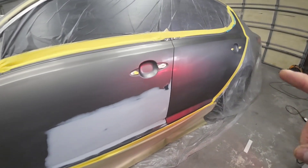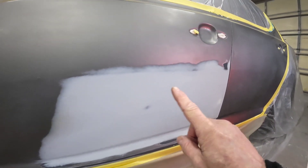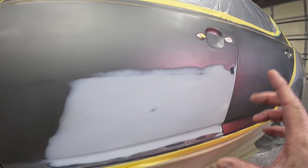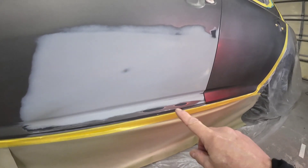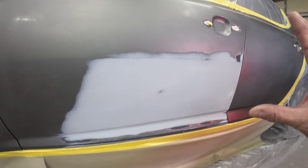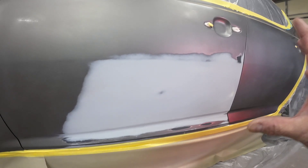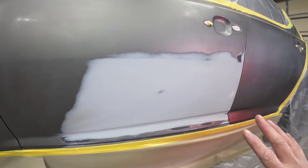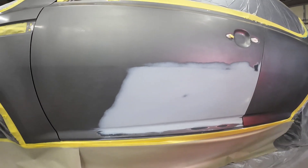We need to prep the surface for paint. This is the vehicle we're working on today — a Kia Optima that we straightened a dent in this door. It had a good size dent; we repaired it, primed it, and got it ready for paint. We have a couple of little areas where we've broken through the paint, so we're going to seal this before we paint it. First I want to clean it with some isopropyl alcohol, remove any dust or contaminants that may have landed on it overnight. We'll tack it off, mix up our sealer, then apply our wet bed.